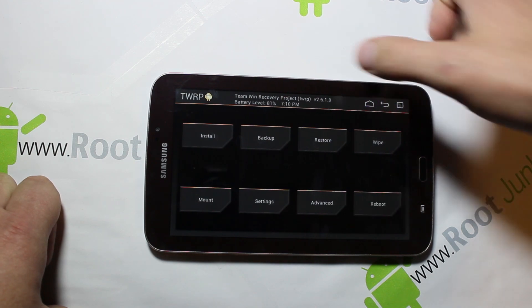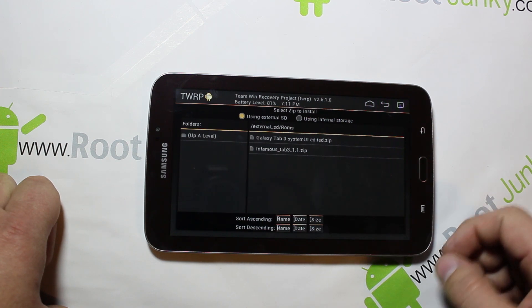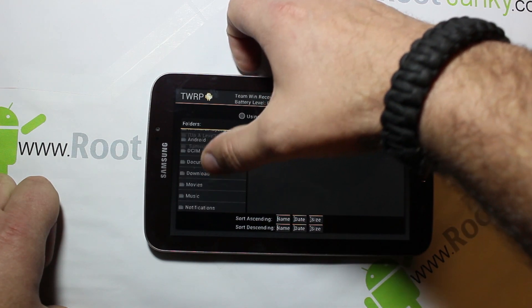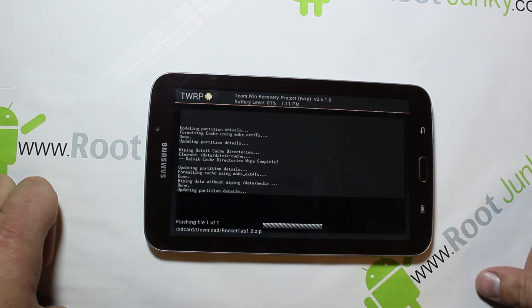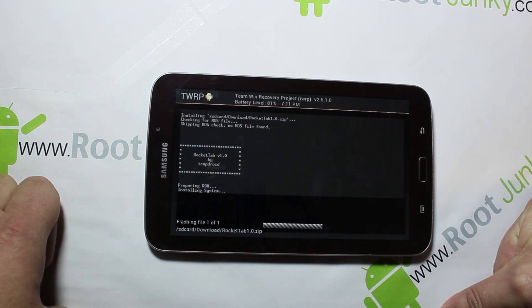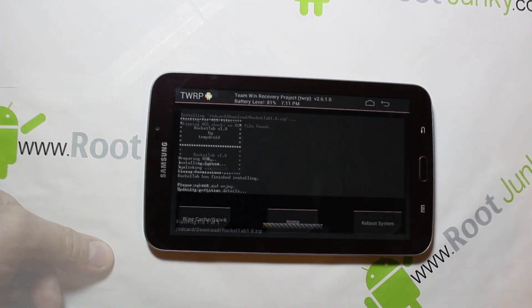Then we go back, go to installs. I can see some Infamous Tab stuff there but I'm going to go to internal storage, go to Downloads, and flash the zip — the top one — and go ahead and flash it. This shouldn't take too long; it's not a huge file. I think it's around 300–400 megabytes, and the extra applications zip is about another 300–400 megabytes as well. Pretty simple process — it's not hard. I'll let this flash and we'll boot the thing up.